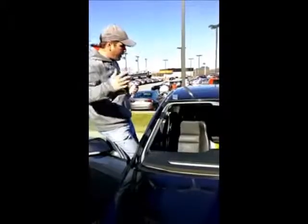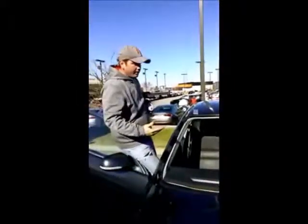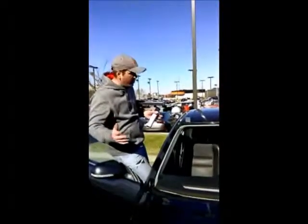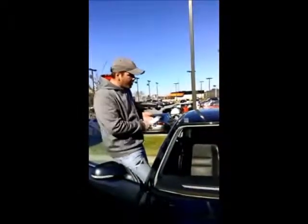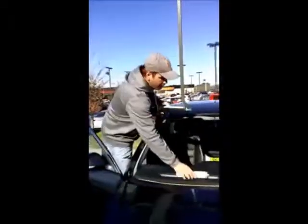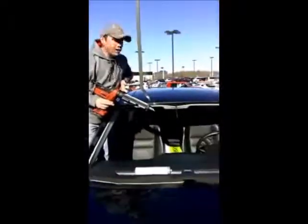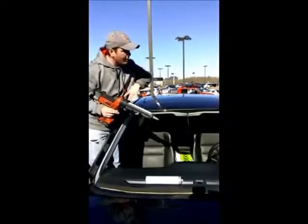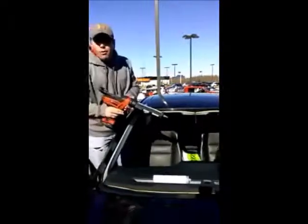Bead on the vehicle, very important step here. If you were to get into an accident, your front windshield plays a huge part in front and rear end stability to keep your car from smashing. So this right here is very important. I like to run a solid bead all the way across the top. That eliminates any type of seams that may be up here, and that's just less chance for water to get in the vehicle.